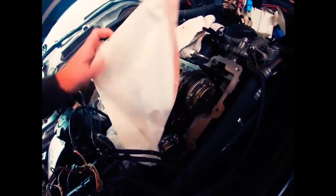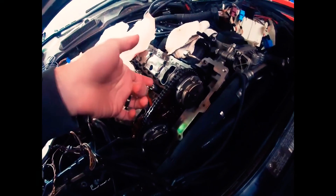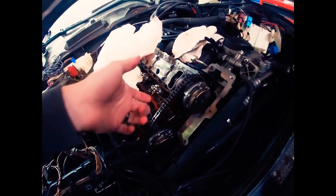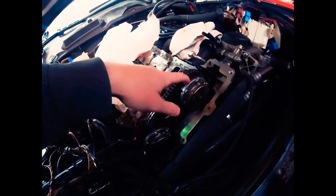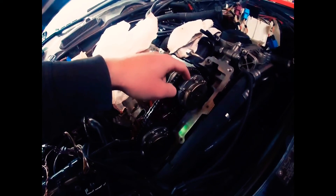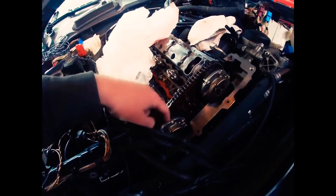What is up everybody, my name is Ryan and you're watching Project Race Car. Today we're going to be attempting to fix my BMW timing issue. If you guys didn't see the last video, basically we're going to be looking at these two timing sprockets. When the engine was being put back together, he swapped the two timing sprockets and they're not swappable. This one is currently on the intake side but it's an exhaust sprocket, and this one is an intake sprocket on the exhaust side.